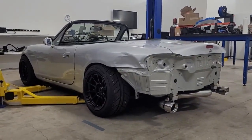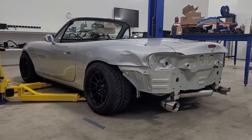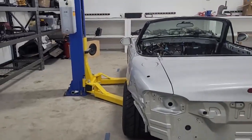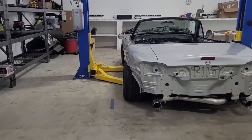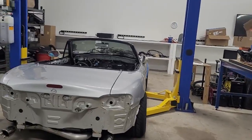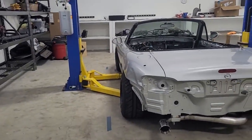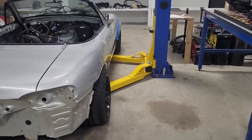I used to have the back maxed out to reduce camber because I'm drag racing - I want the tires straight up and down. But now you can see we have a lot of camber in the back. It's probably close to two degrees, maybe two and a half on one wheel. I don't know why they're different - this one looks like maybe two, the other is two and a half. Whatever, that's not going to work for drag racing, but we got a plan.